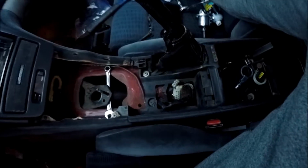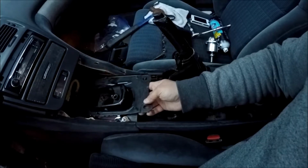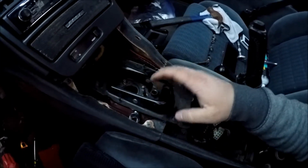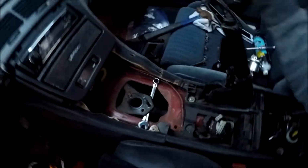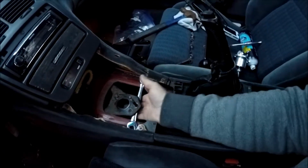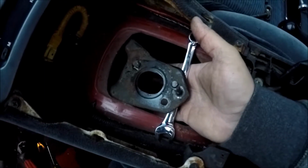And then you take your two rubber boots off, and then this plate is on here like this. You take the four bolts out of each corner. And then you take the one bolt out right here, which holds this assembly on, and this plate will come off. And then what you want to do is reach underneath here